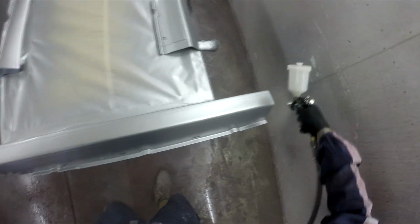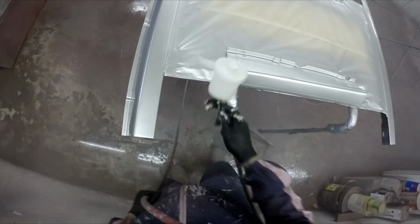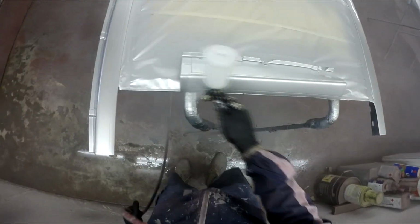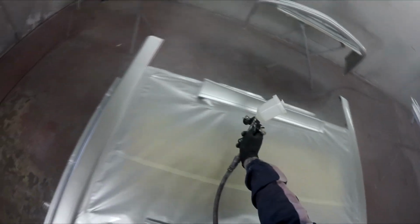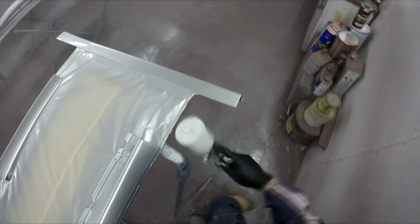All I did to set it up for this, I do change those settings around. I find for base coat you'll use a little bit less if you turn that pressure down, but for clear coat, this is a HS clear, so you need a nice amount of pressure. I've just got that pressure maxed right out. I've got the fluid just about right out, and I've also got the fan right open, so really easy settings. Just open that thing right up, and for HS clears, even MS clears, I'll probably keep the settings fairly similar. I may turn that pressure down a little bit for a thinner MS clear, but hey, there is no one gun setting that is going to work for every single application.